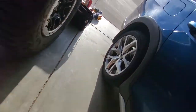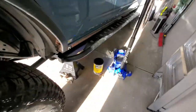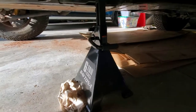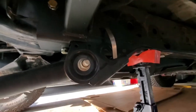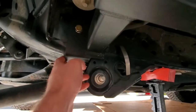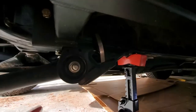The passenger side is much easier — I'll show on that side. The slider is fully installed, tightened down. On this side you've got more holes to work with. On the other side I actually did take the lower control arm bolt out and had to use ratchet straps to try to pull it forward, and it was a nightmare. I tried it differently here and it worked. You should definitely just jack it up, let the control arm droop, and sneak the bolt in.